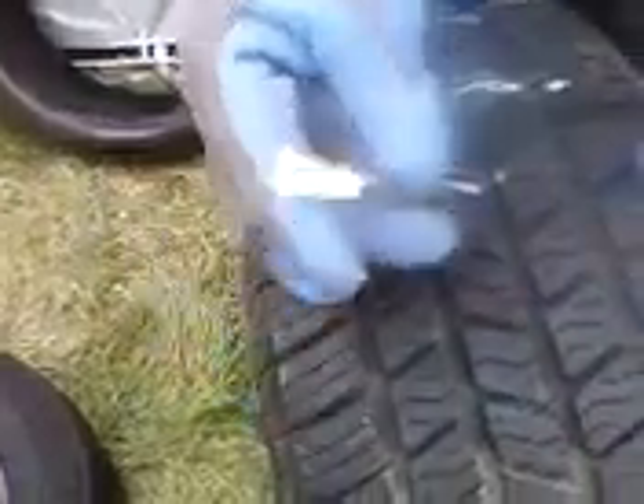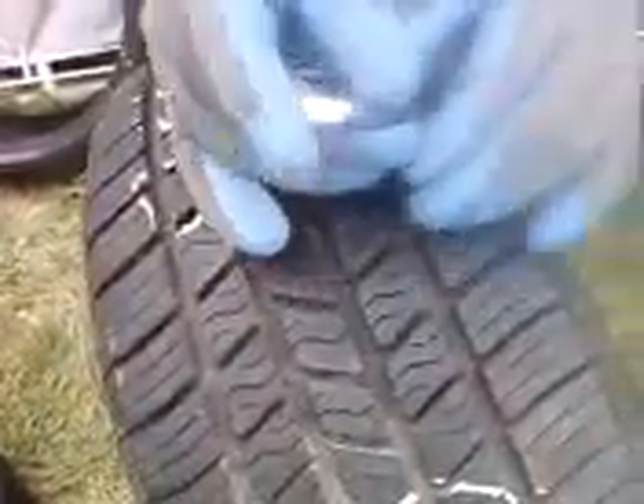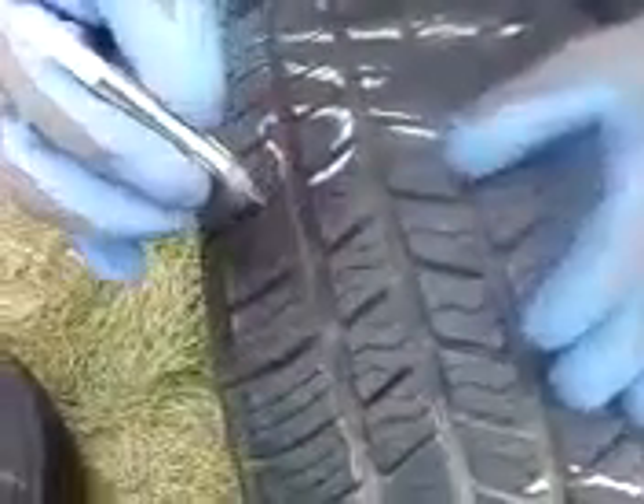You go around to different spots all over the tire. See that right there — it's about 7 millimeters, and that's towards the end of the tire, so this tire was driven on a little bit. Now there's about 7.5 millimeters, so basically it'll be about 7.5 millimeters across the top.